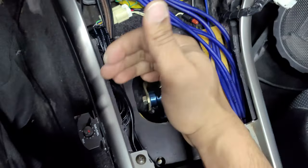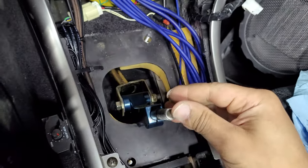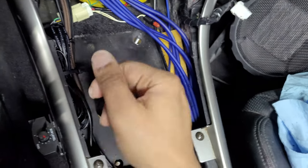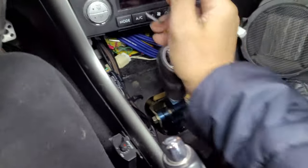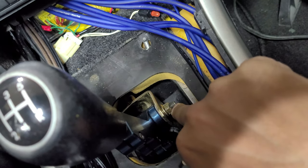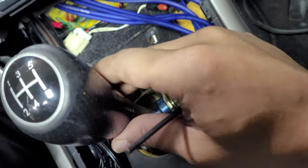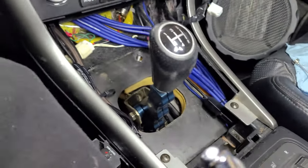Okay so I got the bolt back in there. Now we can start playing with the adjustments. What you're going to want to do is go through your gears and make sure you can get into all of your gears, because you're going to have to adjust it to make sure you can get into second and fourth gear most likely. As you can see, that doesn't want to go into second — it'll go into first no problem. So I'm going to play with the adjustments here. We're going to go grab a size three allen key and get into the side bolts over here. The bottom bolt controls the length — essentially how high the fork is going to sit from the chassis. The top two just hold the shifter knob in. So the bottom one adjusts the throw length and the top one adjusts the knob height. The Cobb instructions are not very clear on that, so I had to play with it a little bit.